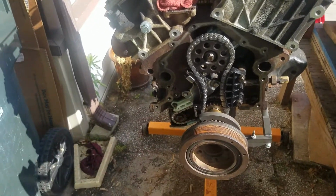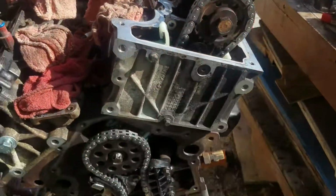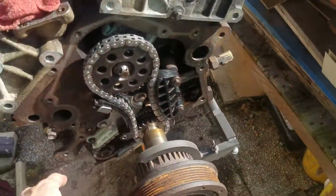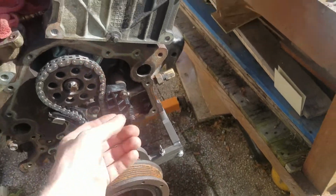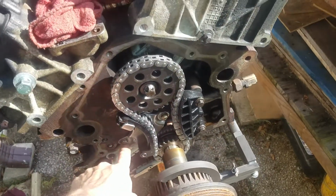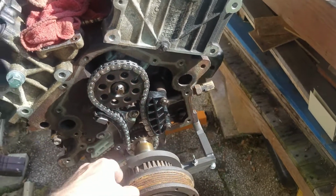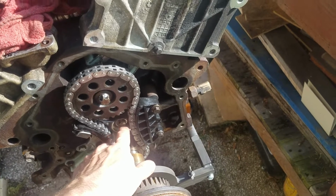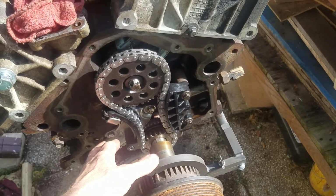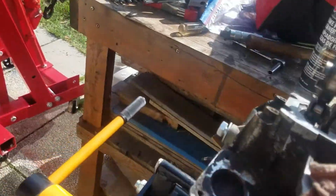You just got to follow procedure and replace your fasteners. All the ones that you take off of here, replace them. Replace that one. Replace this one. Just replace them. Some of these I was able to find at Napa. They had those type of ones, but Napa wasn't open today, so I got a Class 8 one from Home Depot. They're supposed to be good up to about, I think, 36. But you're only putting 8 foot-pounds on them. So yeah, 8 foot-pounds, that's no problem. That'll hold it.